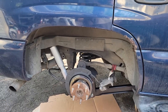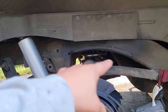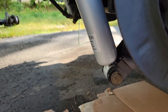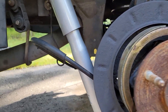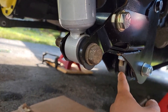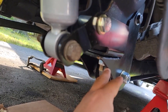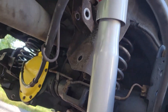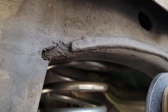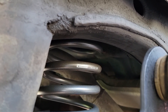I'm still waiting on brakes — I'm gonna do some brakes and probably throw on the new shocks and new springs. So far we've talked about the free travel mod, the lower control arm extenders, the shock extenders on the back side, and the hardware you're gonna need for both of those — remember you've got to find a longer bolt if you go with the two brackets. The shocks are a Bell Tech street performance shock — I'll throw a link in the description. The springs are a three or four inch lowering spring from Bell Tech.